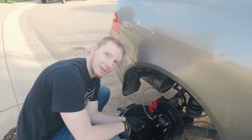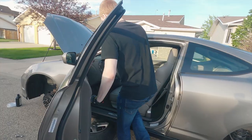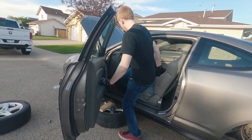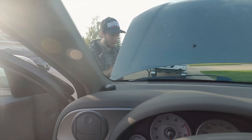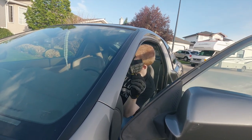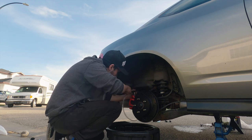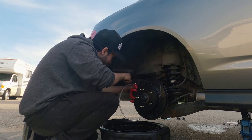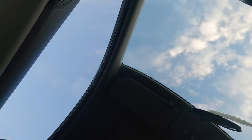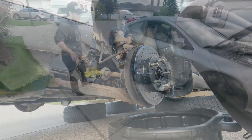I suppose I'm the one hopping inside, or what do you want to do? You have longer hands. I'm gonna hop in. You watch the car for movement. Run to the back one, the farthest one away from the reservoir, and I'll get you to crack it, and I'm gonna hold this pedal down. Now tighten it — I'm gonna pump up the brakes. It bubbles. Nice, close it up. This brake fluid is black, man. That's not good. Cap on — okay, it's tightened. We're done.